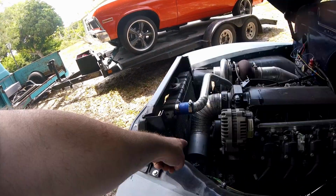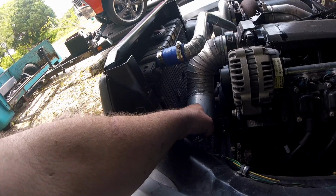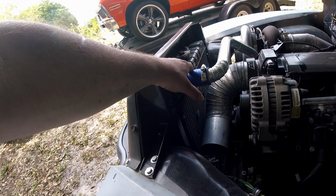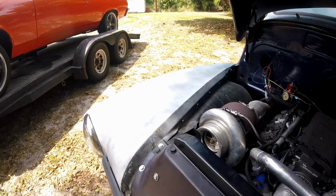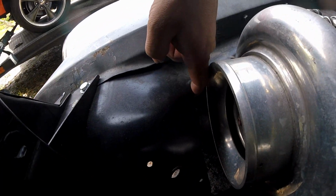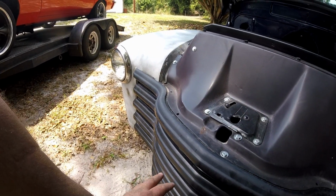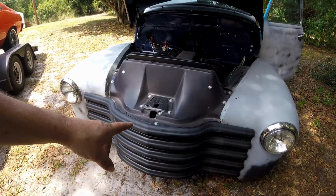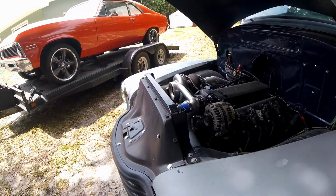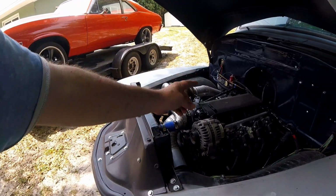I've got to add intercooler pipes because all I've got is basically just this little intake. I think the radiator might be clogged, so I'm going to end up getting an aluminum one. That's basically where the intercooler pipe stops. I'm going to go around. I have something in the works for the front for the intercooler, super tight in the back, and then right around, and I probably will do 3-inch, step it up to 3.5, and then 4-inch going in.